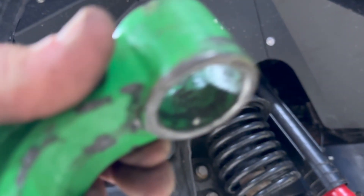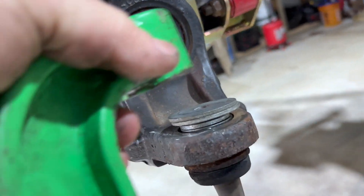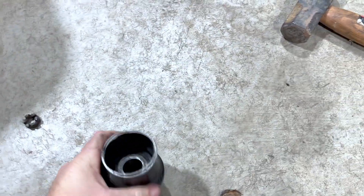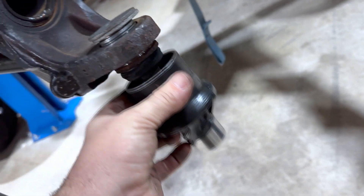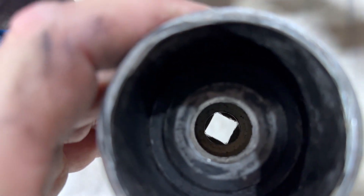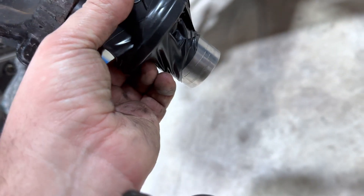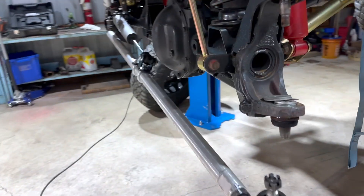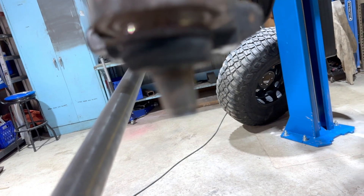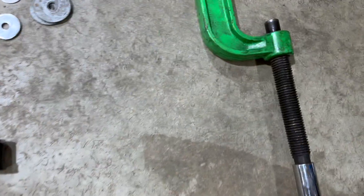I put the thick washers on to catch the outside of the joint, set that on there, and then I've got this — I know it's sketchy: a socket taped to the adapter taped to the receiver cup. At some point I'm going to run out of throw because it's going to hit the bottom, but hopefully by then I can just pull the thing out. It wasn't going great, but it was going okay. It was bottoming out like I knew it would, so I got out the old trusty porta band and cut that off so it can't bottom out. I finally got it.